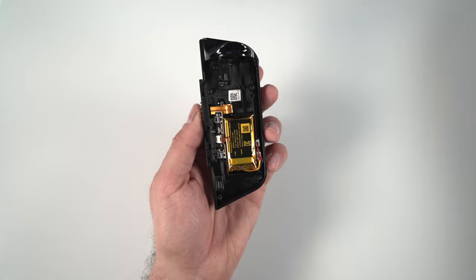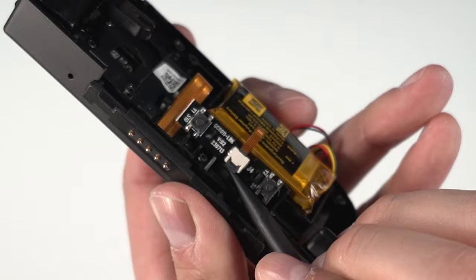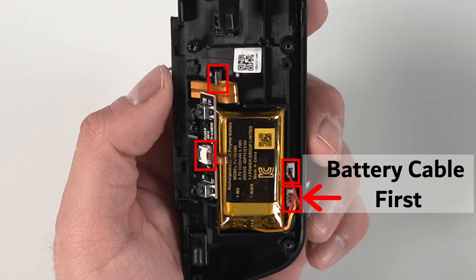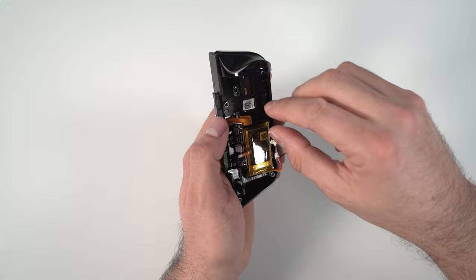The next step is to unplug all the cords starting with the battery — the red and yellow one — as well as the black and red; you can just pull those straight out. There's one ribbon cable with a little flap you need to lift straight up before pulling it out. Make sure that flap is up any time you remove or reinsert the ribbon cable. The third type of clip pushes straight down so you need to pull it up — go from both sides to lift it evenly. I strongly recommend using a plastic spudger to avoid damaging anything. Make sure you handle all cables with care as ribbon cables can be delicate.